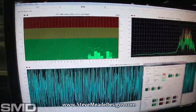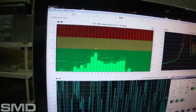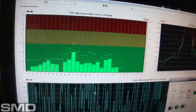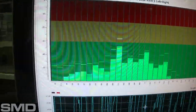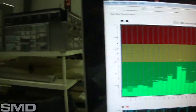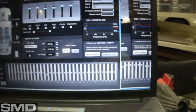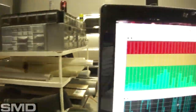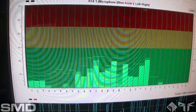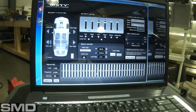I've now got a hint of 16k and 20k where I didn't have them at all before. I don't want to raise these through the roof — just small adjustments. Now I'm on the four-inch mids and I can see a big buildup at 315 Hz — the yellow line is all the way up. I go to the EQ and move 315 Hz down a little bit, and now it doesn't peak up as far.